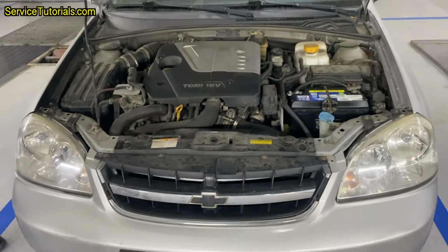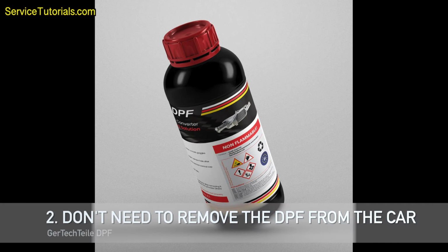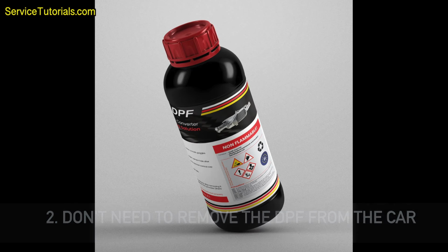So, as a short conclusion, 1. The GerTechTeile DPF cleaner works efficiently and fast. We demonstrated that GerTechTeile DPF cleans the particle filter right from the moment it is inserted on the hose from the differential pressure sensor. 2. The advantage is that you don't have to remove the particle filter from the car. Cleaning is done with the DPF filter mounted on the car. As you have seen, the cleaning process is quick and easy, in just 40 to 50 minutes.